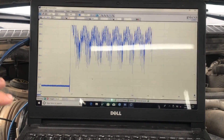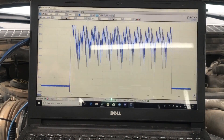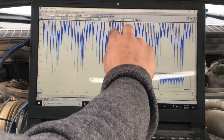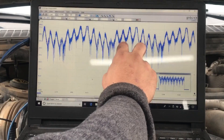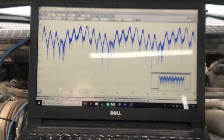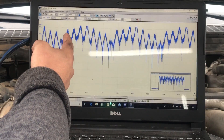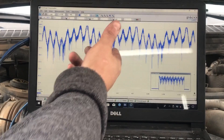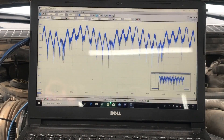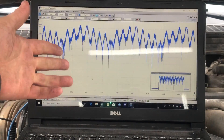I don't know if you can hear how it's not consistent when we actually try to crank this over. Remember this is a V8 so we're going to have eight humps. As we can count right here: one, two, three, four, five, six, seven — and look at that drop right there. That's our mechanical issue. When I cranked this engine over, it didn't sound consistent, and that lets us know we do have a mechanical issue.